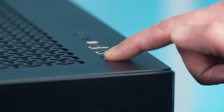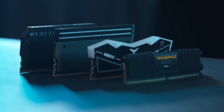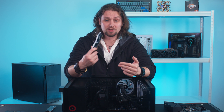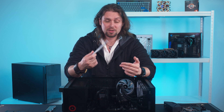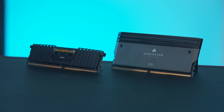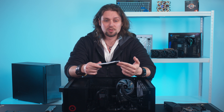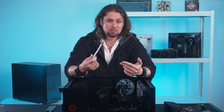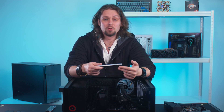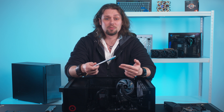It's worth pressing the power button once when the PC is unplugged, just to make sure there's no residual charge. Now let's discuss the RAM itself and what type you need to buy. It's vital you check your motherboard and CPU specs before you purchase your RAM — you're looking for what generation of RAM your motherboard and CPU support. Generally it'll be DDR4 RAM if it's an older motherboard, or DDR5 if it's newer. You also need to know what speed of RAM your motherboard supports. As a general rule, the faster the clock speed the better the performance, but not all motherboards or chips support or need the fastest speeds, so double check the spec sheet for your particular motherboard and chip combo before you buy.